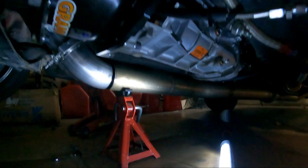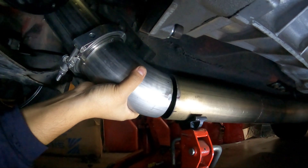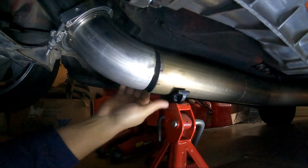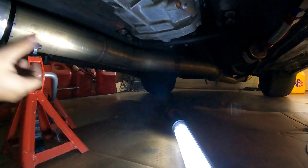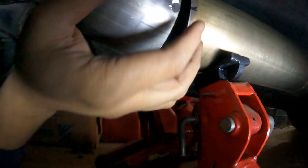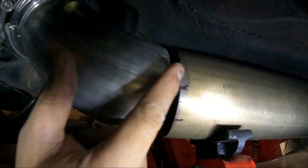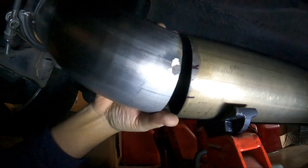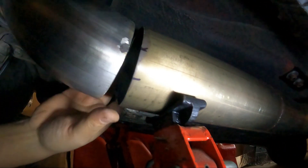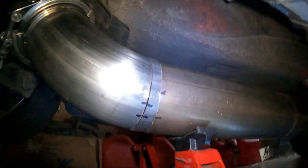What I was originally going to do — the pipe was originally twisted, and I was going to have to force the exhaust pipe over this way which would move my tailpipe. I don't want to do that. So I'm going to clock this back to where it's flush. What I'm going to do — it's like a pie cut — so I'm going to get the measurements from here to here, and basically turn this into the perfect pie cut to fill this gap. I think I've got it.